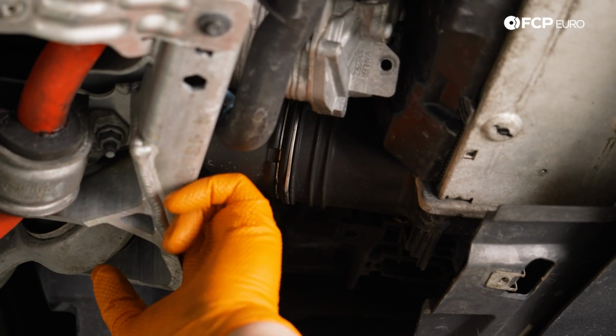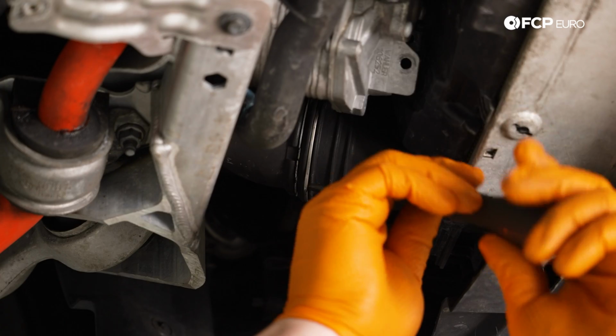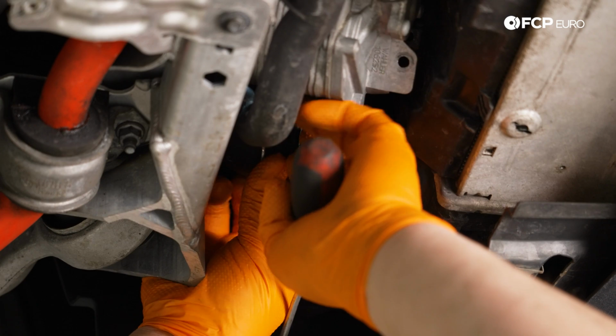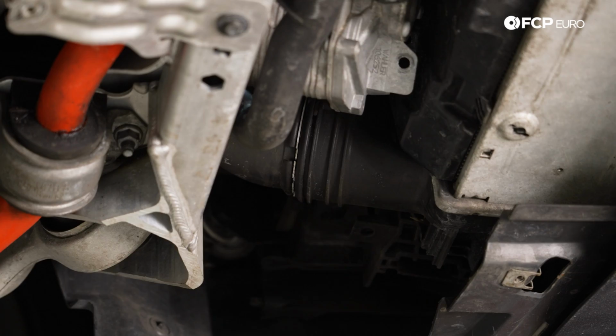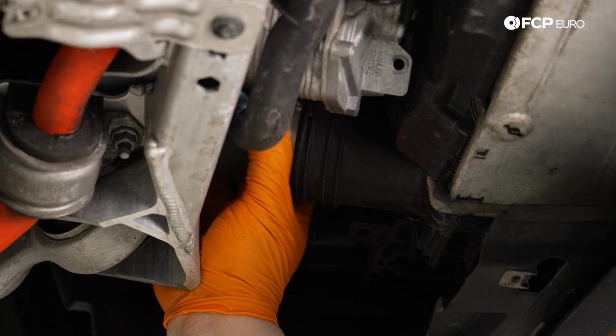This intercooler piping that we're going to unclip from the bottom here just has a quick disconnect style clip like our radiator hoses do. We're just going to pry that down using our flathead. I like to remove these sometimes if they start coming off, just so that we have nothing hanging us up. We should be able to work this hose back just to free it up.